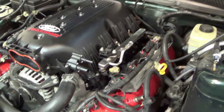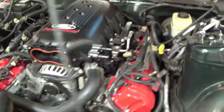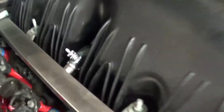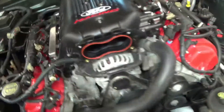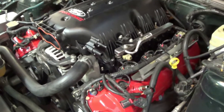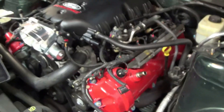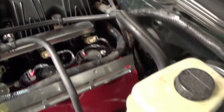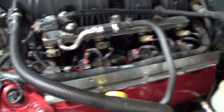The manifold is in. Put a little silicone grease on the O-rings on the injectors, put the injectors in, tightened the fuel line, tightened the fuel rail holders down on both sides. Now it's just a matter of plugging some things back up before I can put the throttle body on. I'm going to try and connect up all the hoses I can first. I think I've got everything plugged back up - fuel line and vacuum lines are plugged back up, and the injectors are all plugged back up.